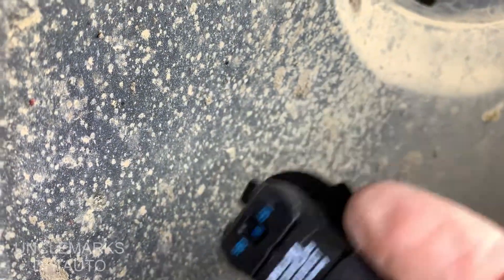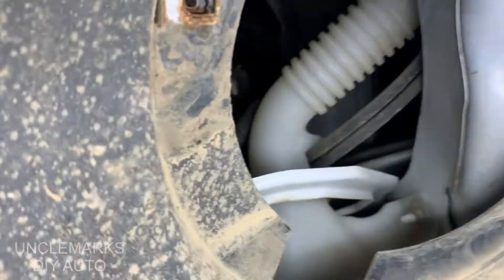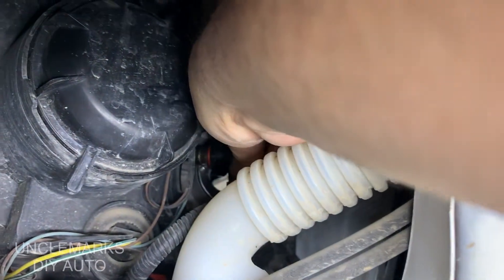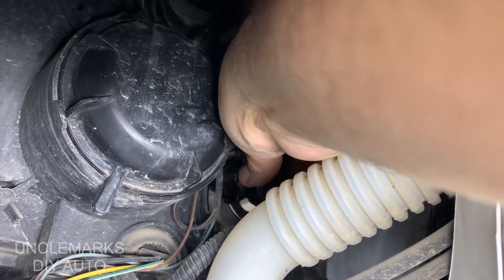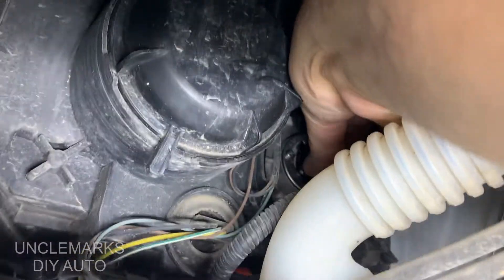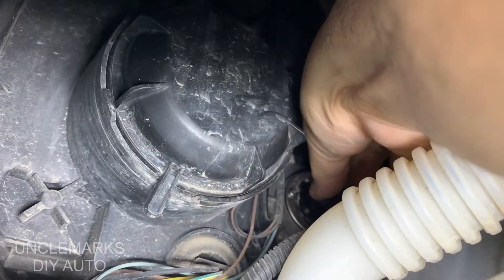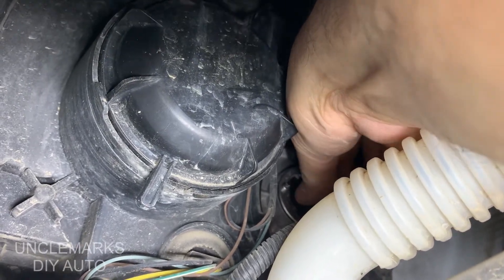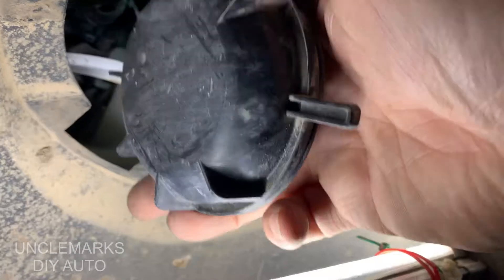See the configuration there — let's try and put it back in. This took me a while and like I say it was totally by feel; you can't see what you are doing. Once you kind of get the bulb in the hole, it's a good idea not to touch the glass bulb because oils from your fingers can get on there. Then that bulb gets hot with an oily film on it and it can burn it out.